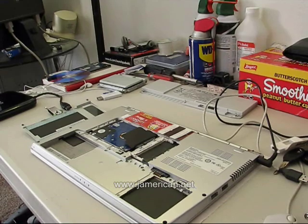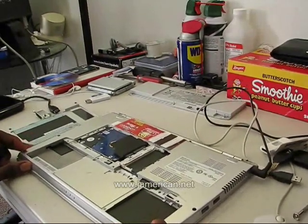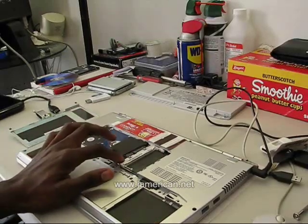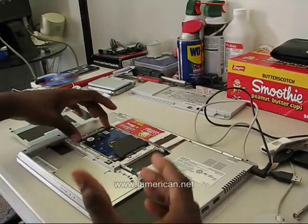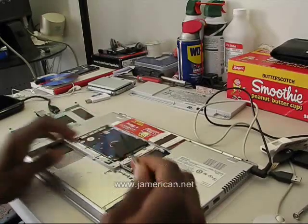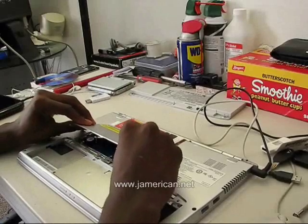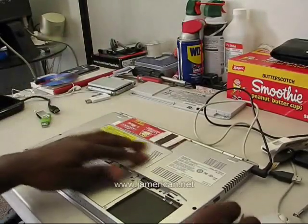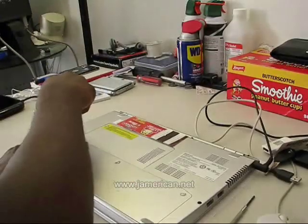Once you've installed Windows on your SSD, slide the drive back in and make sure this corner goes above the hole — all corners go above the hole. Slide it back in, tighten down the three Phillips head screws, then put down the metal casing and hand-tighten those three screws. Then put the battery in and you're done.